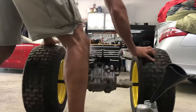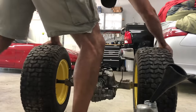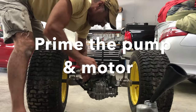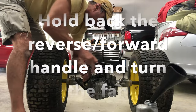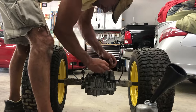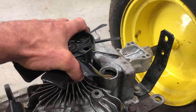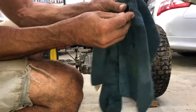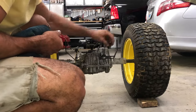Shake the transmission around. I'm going to put it in reverse and tip it all that way in. Fill it almost right to the top — about a quarter inch from the top since the pump's primed. The next step is to clean your magnet — it's all good. Drop her in, put the cap on.